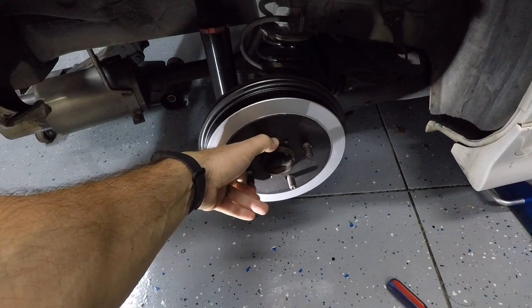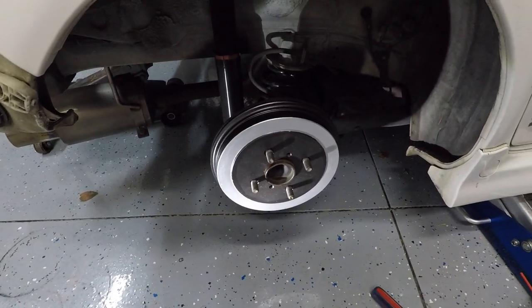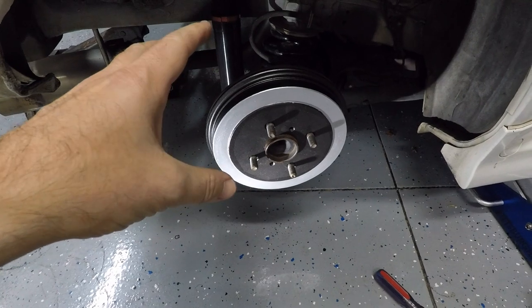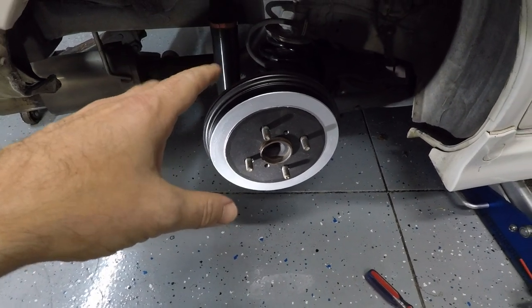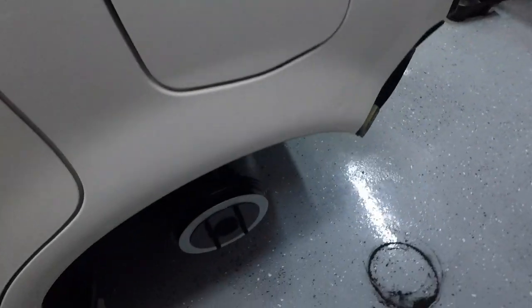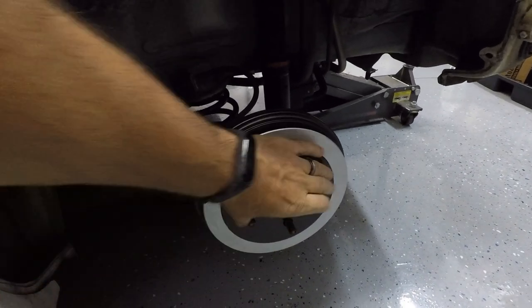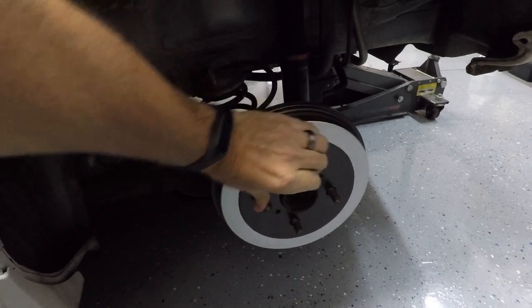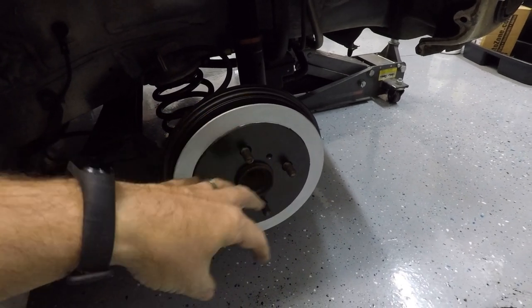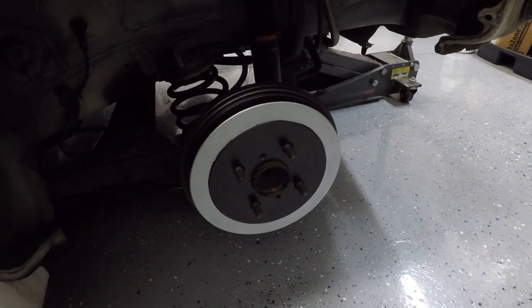It's as if the e-brake is on — it's a little tighter than I had hoped. The other side, although tight, is not as tight. That side I can kind of turn it with a little drag on it, which is what I want. I might pop it off on the other side and loosen the e-brake spring a little bit to get a similar result so they're even.